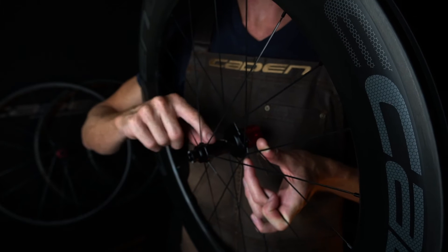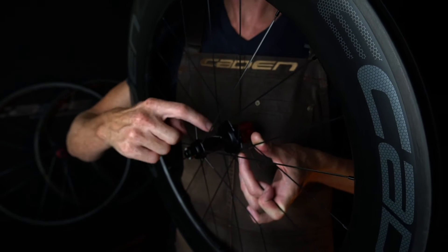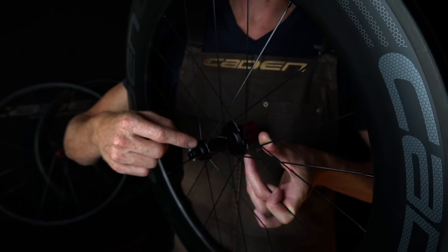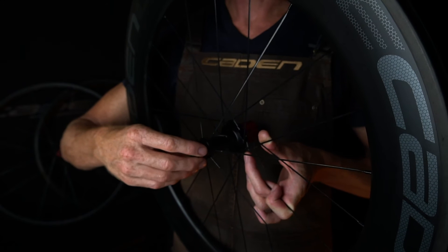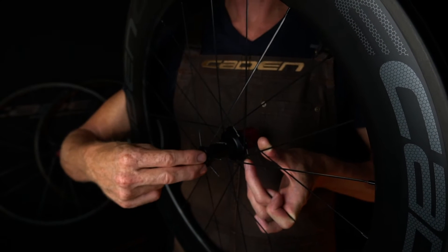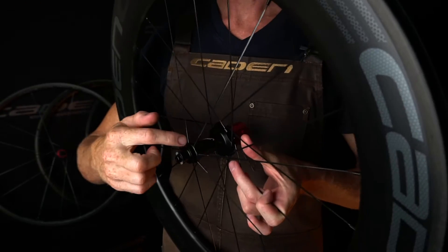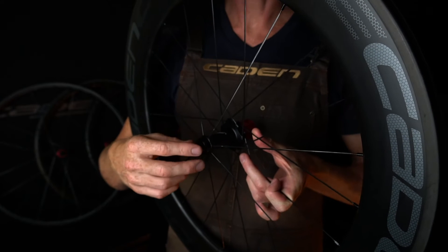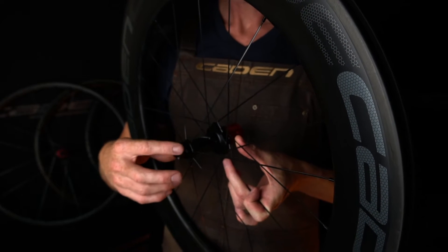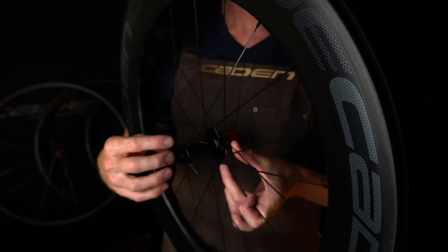You can see the hub shell itself isn't creating a lot of drag. It's very stiff — you don't get flex through here. The flex comes from the axle itself and the end caps, most importantly. I use an aggressive thread to lock these end caps on so they can't start wiggling. If you use a slide-on end cap, it can move slightly, especially after 3,000-odd kilometres, and then you end up with a little movement here which equates to a lot of movement here. These stay very stiff, which is important in a TT bike because under-bottom-bracket brakes can be an area of rub.